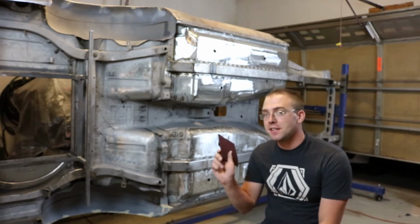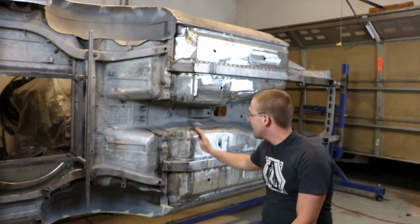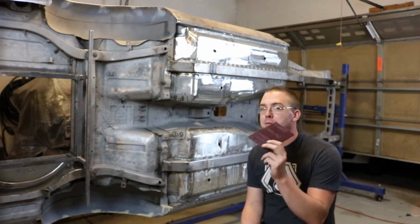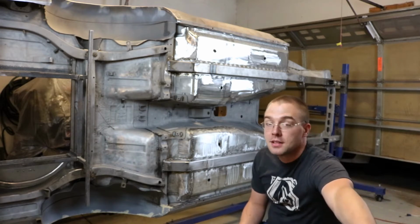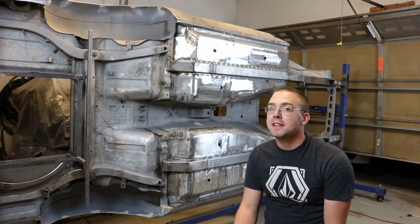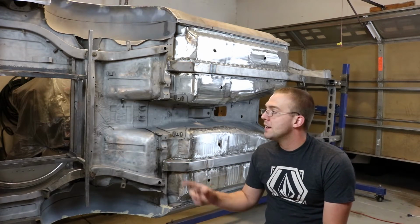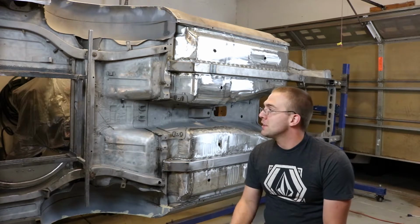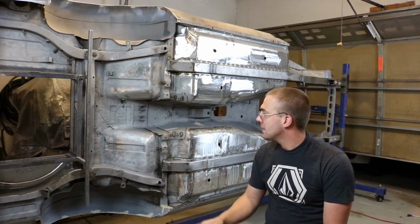Today's video is about the 2JZ 240Z. We're going to be scuffing up all the metal with red Scotch-Brite, wiping it down with isopropyl alcohol, and then hopefully, if we have enough time, we will spray primer. I'm mainly going to do the underside today, and then it may or may not be in this video, but I'll do the rest of the car like tomorrow or the next day.